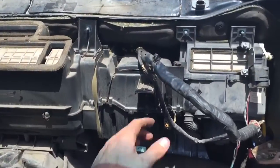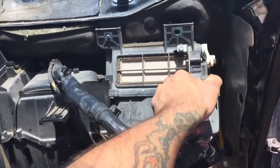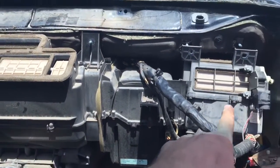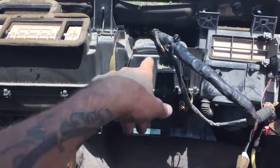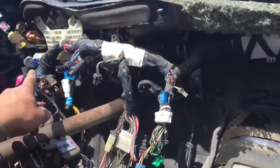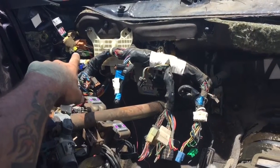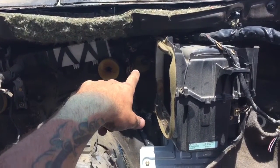The heater is ready to come out. Once you get all the fasteners off it kind of just falls out - there is some movement needed, but we're gonna take the blower and the heater core assembly out. We're gonna leave the air conditioning unit here because it has AC lines in the engine bay that we don't want to deal with. There we go, the heater box and the blower are out. Now you can see the main bulk of the harness - over there is the main ignition relay, just below that is a fuel pump relay with the green connector. We're pulling this entire string, and you'll see there's a grommet that goes into the engine bay right there.